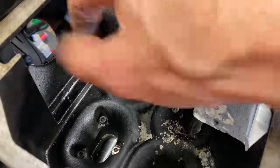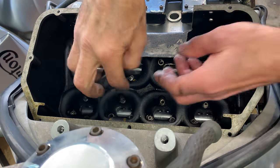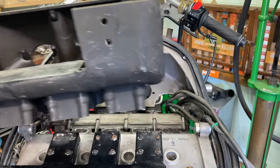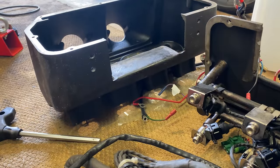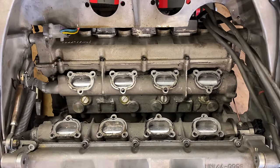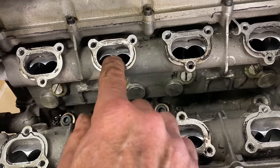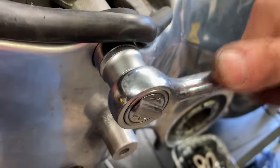One of the strangest things is that the battery sits in the airbox with no top cover, so air can leak in all around the battery. You have to be really careful with bits dropping down into the engine, especially during servicing. With the last screw removed, the magnesium airbox lifts straight off the engine. You can then see the eight induction ports and the two inlet ports at the front, and the cutaway for the battery. I disconnect the throttle cable and notice the throttle linkage hits the engine at the front on full throttle — the butterflies are only three-quarters open, maybe just over half, which is not ideal for performance. I'll need to look at the mechanism to increase its movement. So now I've got to take the engine out of the bike.